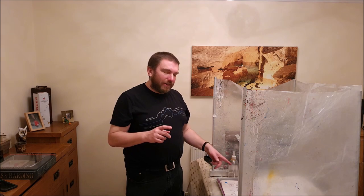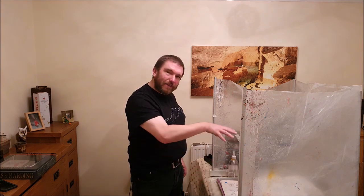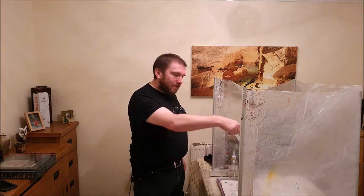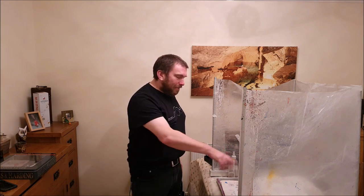Now I'm going to mix up some candy orange and spray it through that lace, not too close, I don't want to blow the lace around even though it's quite tightly magneted to that steel. So I'm going to do it from a fair distance and get some nice coverage over there to bring that pattern of the roses through.